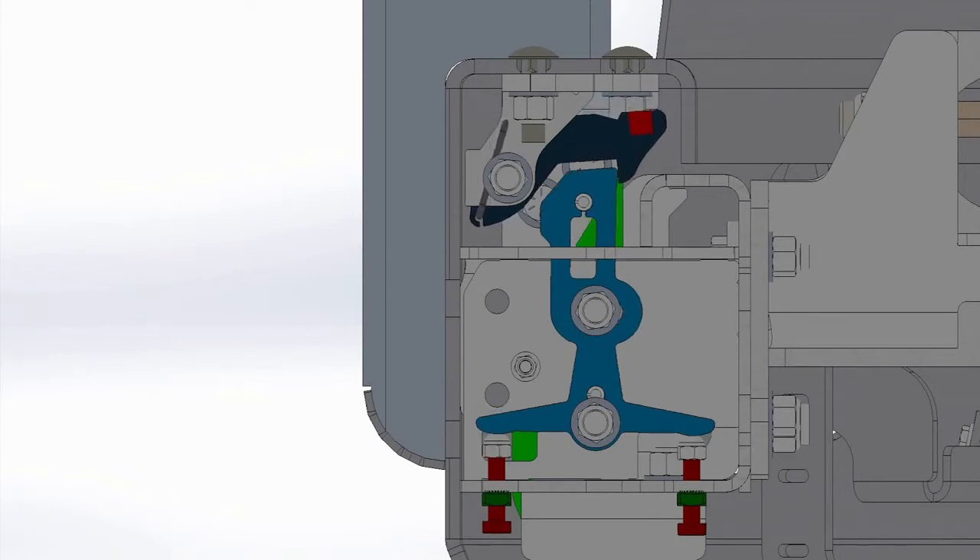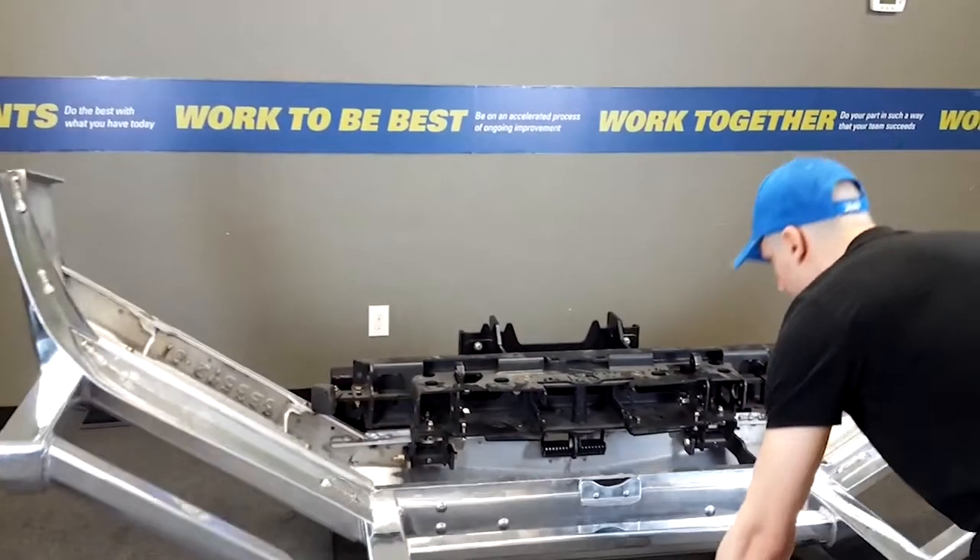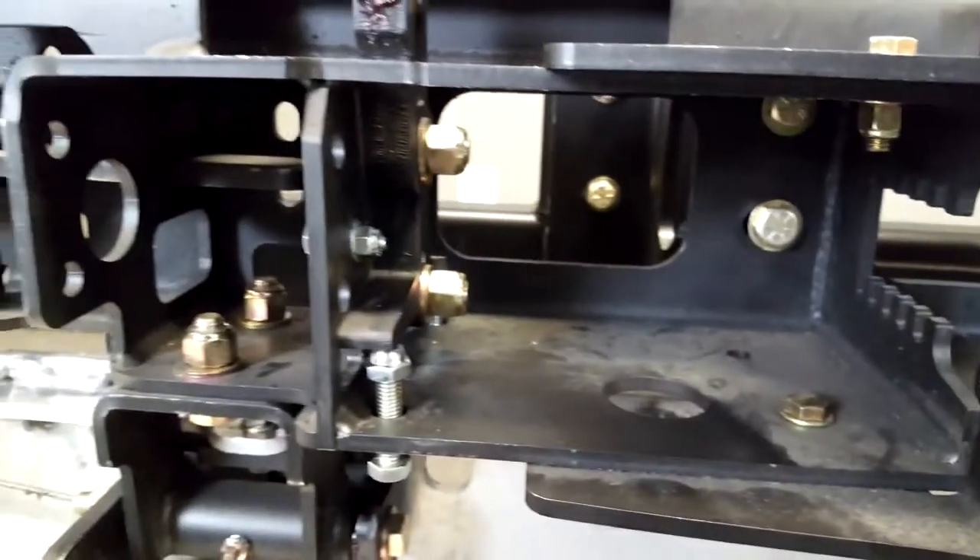This is an example of a perfect adjustment. The ramp plate will be near flush with the claw and no rattling should occur. Open the bumper to access the mechanism. The slam-latch adjustment must be carried out on both driver and passenger sides.